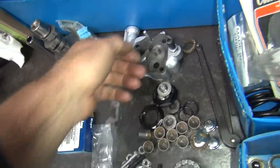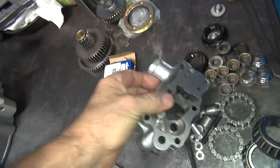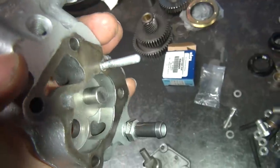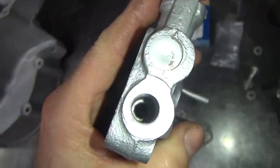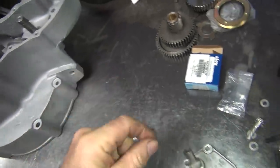Get this lower end going. I also took the oil pump and plugged up the fitting there, painted the pump, scratched the pump. And it looks like I got some paint in there maybe still. I also lapped the ball seat down in there with a lap — that'd be a ball bearing welded to the end of a long rod.